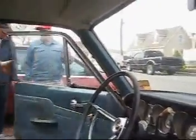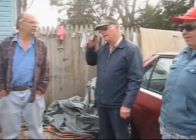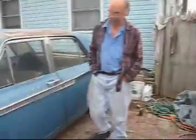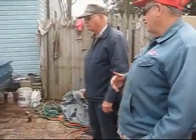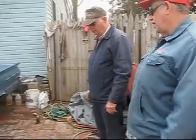Had a valve to put in. Jumping, yeah, it wanted to come out of the cradle. Now it sits in there and it doesn't move. Nice. Got all the valves working now. And it's shifting. See what it was doing before, Bill. It was using vacuum. You had a burnt valve, and the motor's trying to adjust for the burnt valve, and the transmission's trying to get vacuum, which it can't get. You had two things fighting.